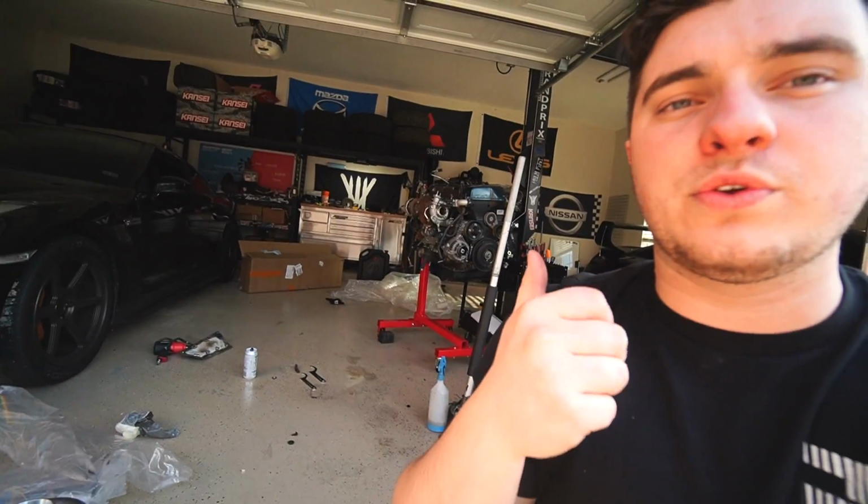Now, what I'm gonna do is go stock ECU. The Supra GE ECU and stock MAP sensor can actually hold up to about 5 PSI. They're about 30% of a bar. So it's gonna be really low boost, probably rocking 220 wheel horsepower, 203 wheels, but who knows? It might end up doing good, might go standalone. I have a whole fuel system coming for this motor, but we might use some of it, or at least maybe my old GTR injectors, like up it a little bit. We might have a little bit of fun with the GE.